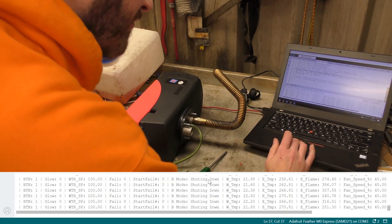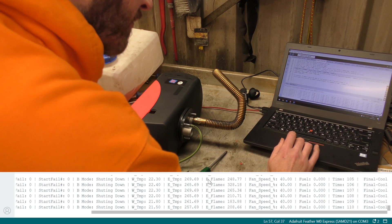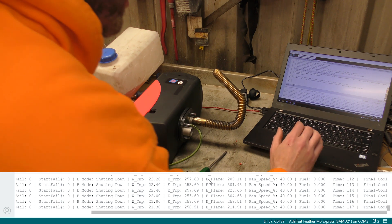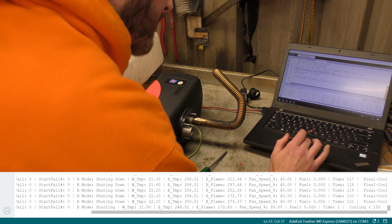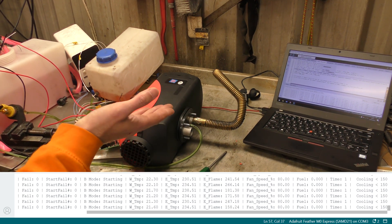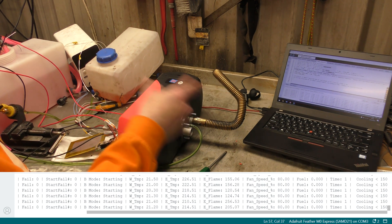I've sort of nearly got it working. It's hopefully going to restart again in a minute. The exhaust temperature needs to climb down from the stratosphere. I've had to tweak the flame sensor a bit, so I might need to play with this resistance reading. The glow plug resistance is probably different anyway, and ours is in a different spot than it would be in the Webasto heater, so I don't think it gets just as hot where it is - so I have to tell it it's hotter so it thinks it's lit.